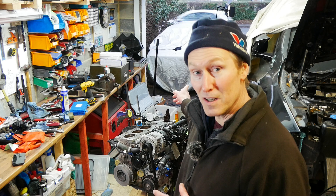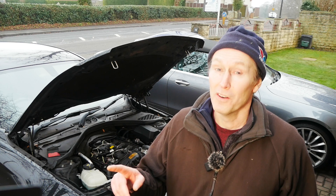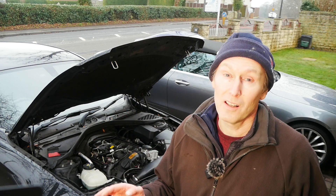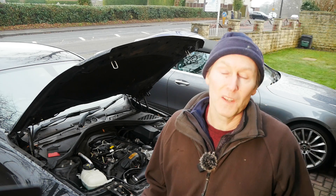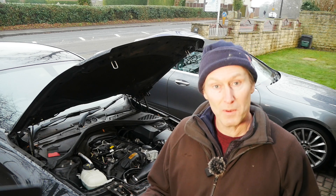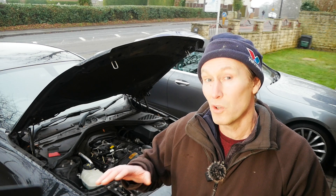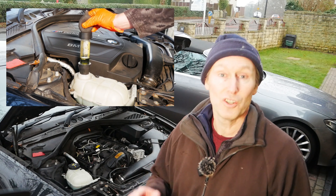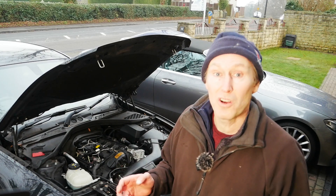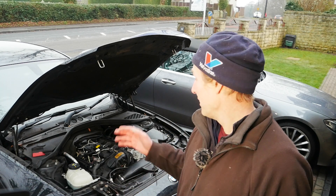Before I finish I'm going to throw in one more bonus piece of information. I didn't mention it in my list of the five most common coolant leaks because I think it is less likely, but it would be remiss of me not to mention it. There's a chance you might have a head gasket leak — if you do, coolant may be getting into your combustion chambers, being consumed, and going out of your exhaust, which would deplete your coolant level over time. I have done a really good video showing you how to do a chemical test of the coolant in your expansion tank, but you do have to follow the instructions closely to make sure you get the results you're looking for — I'll provide a link in the description.